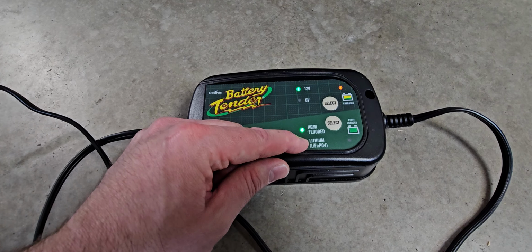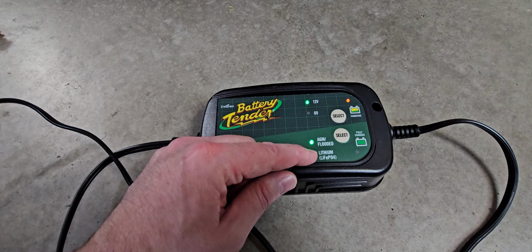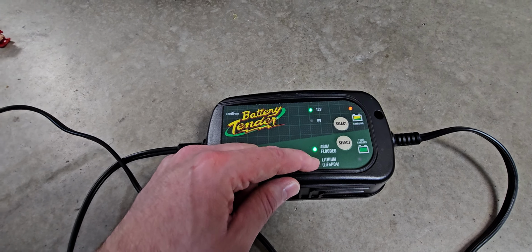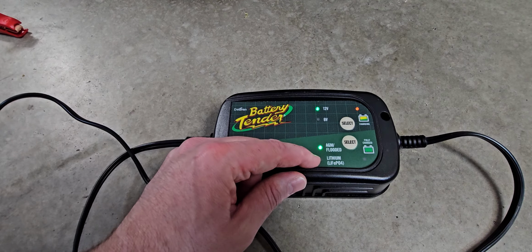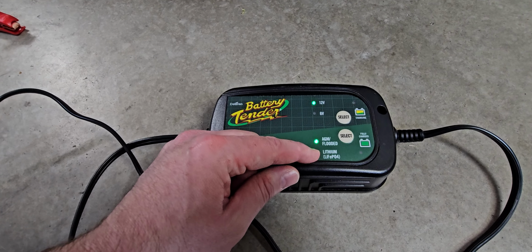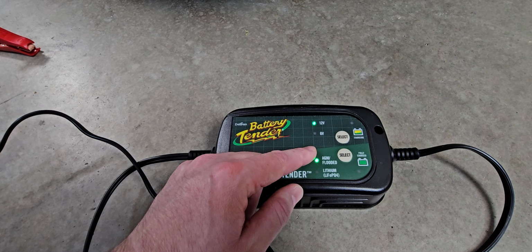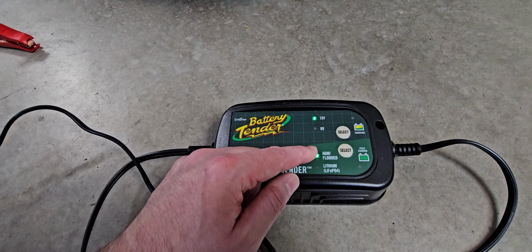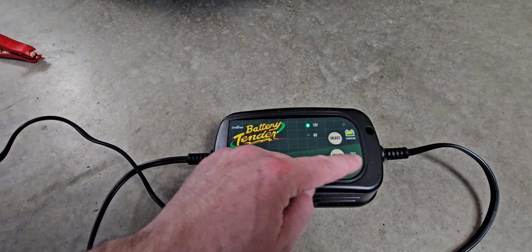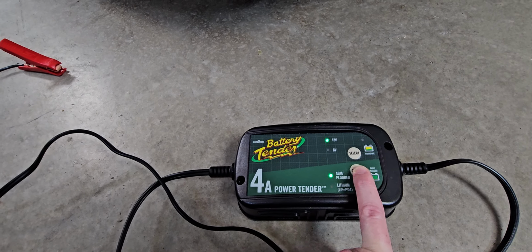These lithium iron phosphate batteries, you can buy these for your car. They're typically not found in vehicles, but you can buy them. I don't really recommend it unless you're drag racing and you want to maximize your quarter-mile times. Otherwise, just go with your standard AGM flooded battery. You're going to get longer life, more reliability out of it, and so forth. You're not going to get stranded. And then you just hit the select button here to change between the two modes.